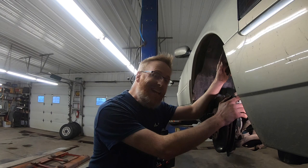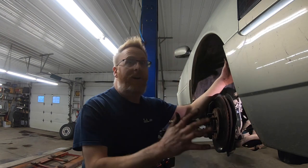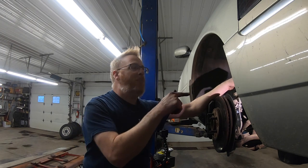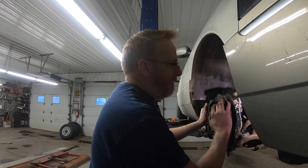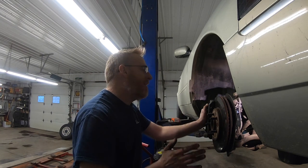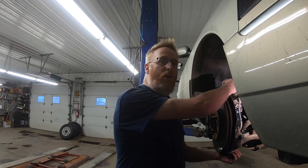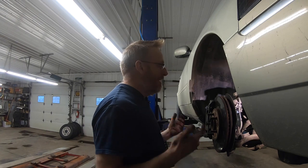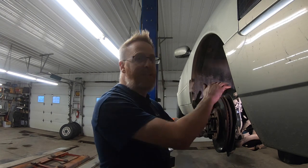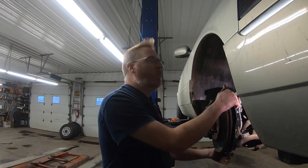I hope you learned something because I did today. This is the first time in all my 20 — we'll call it 25 years working on cars — that I've ever done a lower ball joint on one of these Panther Platform cars. What I found on the other side was that the hard way is to try and find an easy way to do it. You're just as far ahead to take everything apart that's in your way: the caliper, the bracket, the rotor, the sway bar link — then you're left with the tie rod, which you can leave attached, and your two ball joints. You don't need any special tools to get that far. I think we had a 15 and a 14 for the brakes, and 15 for the sway bar link. Pop off that ABS line, and Bob's your uncle — it's pretty much 21mm for the ball joint right in your hand.